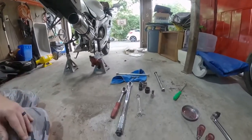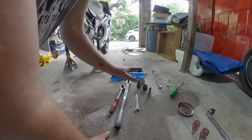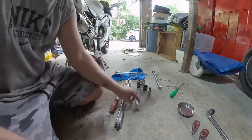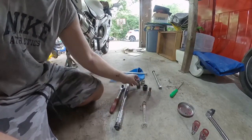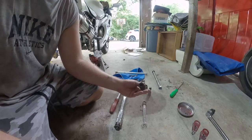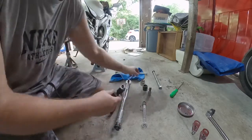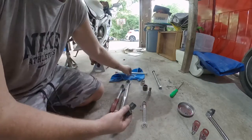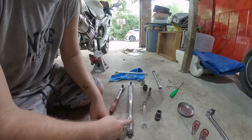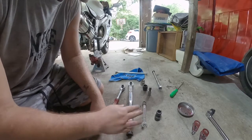Here's the tools you are going to need besides the stuff to take the wheel off and everything else. This is just related to the swing arm. You're going to need a 14mm wrench. This is a 17mm — I used the wobbly socket, but I just like that. This is for the bolt for the shock. A torque wrench that goes to at least 100 ft-lb, just something like that.